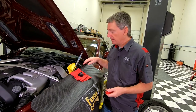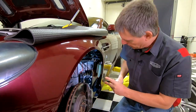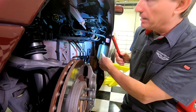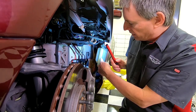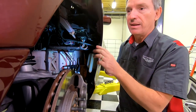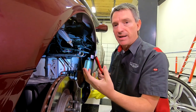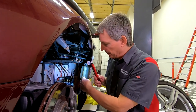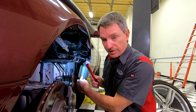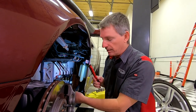But I wanted to point out one thing that confused me. Down here in the fender well, I was doing some work and I discovered this plastic reservoir. This is actually connected to the top of the upper reservoir, so this is the overflow tank. Basically, if the pressurized tank fluid expands to the point where there's no more air space at the top, it has a pressure relief and fluid will come down into this tank, which is at atmospheric pressure.